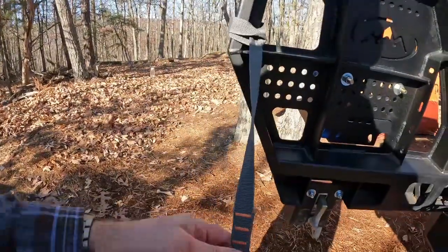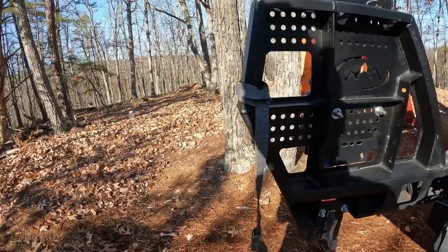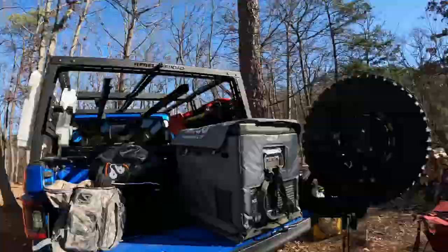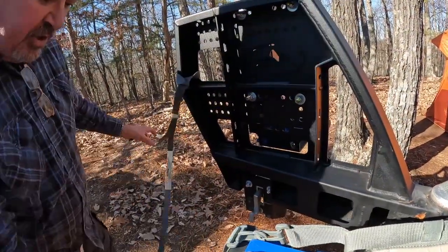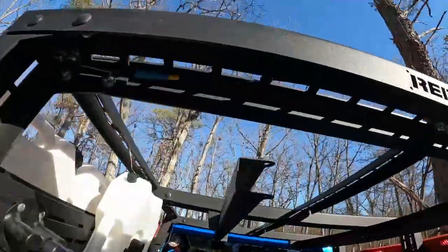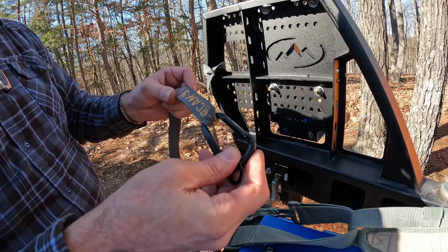I really like the straps — they work really well. They sell them online with just the strap, which is what I got. They also sell them with d-rings and with hooks. I don't particularly like the open hooks because if you get a little bit of slack, a hook can jump off whatever you've got — and when I've got my tent, which is very large and very expensive, strapped to the top, the last thing I want is to see it bouncing down the highway behind me. So I used some d-rings, looping through the strap's loop end and clipping to one of those slots — metal-to-metal contact and no frayed strap.